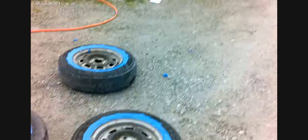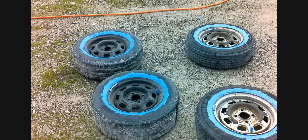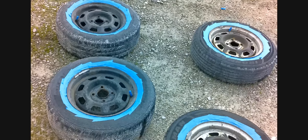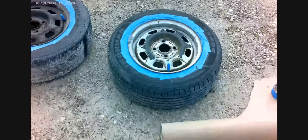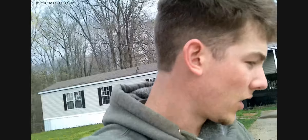I've got the rear rims of both cars out. I'm gonna put some fresh paint on them so I can do a set of four for each - being efficient. I got my roll of paper here and I'm gonna roll it around the rest of the tire. I just want to make sure I get a nice fit around the bead so I can get paint around the whole bead - that way rust doesn't start. I'm gonna get these sanded down and painted.